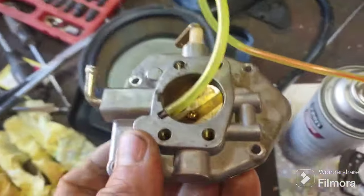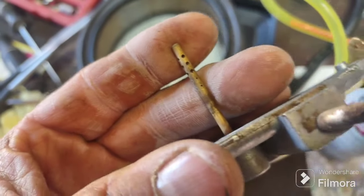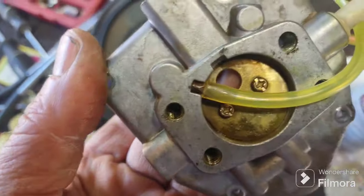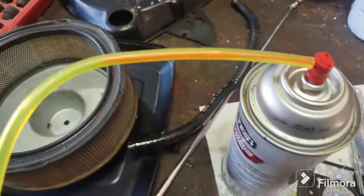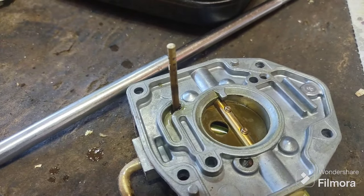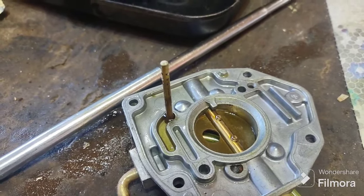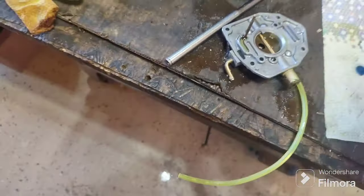I forgot to show you this — here's the top part of the carb. These jets are the same as what you'd see in a Briggs. That's what everybody calls the emulsion tube; I've gone and cleaned those out and they flow right through. I've got the tube from the carb spray stuck into the gas line, slid over the fitting. You should see nice clear jets coming through right there — some spraying out the back by the can, but it looks pretty good.